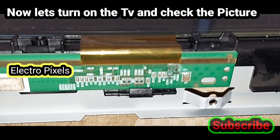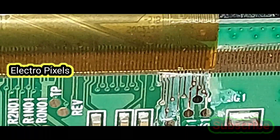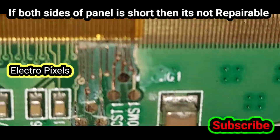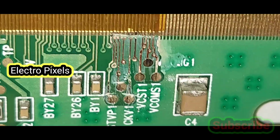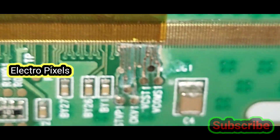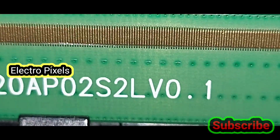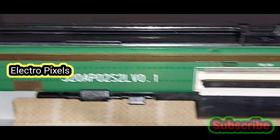This is the left side. First, we need to try cutting from the right side — here I tried to cut the gate signals from the right side. Now I need to reconnect the motherboard back to the panel and check if the picture is okay. If the picture is not okay, then I need to rejoin the cut tracks, reconnect them, and cut the left side tracks instead. If the picture is still not okay after the first step, we rejoin the right side tracks and cut the other side — the left side.